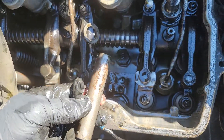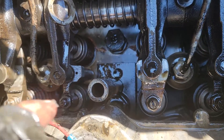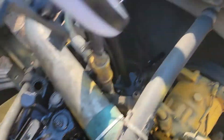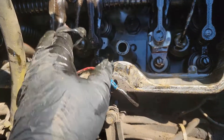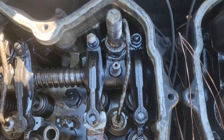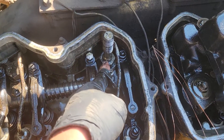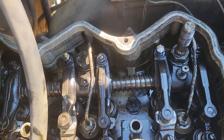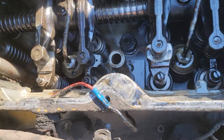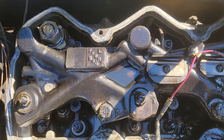Okay, there's the spacers for the bolts — sit right there — and the bolts go down through the jake housing. Better not let that fall in there. The next thing I want to do is pull the valve cover. That washer went on this stud. There's a bolt that pulls the rocker arms, another bolt, and then the rocker arms should come right off. By the way, there is a front and rear.